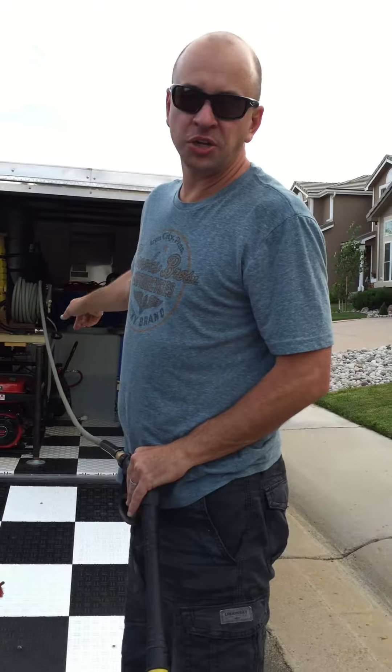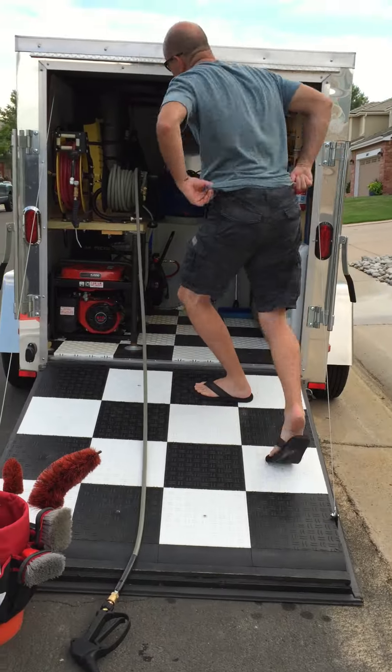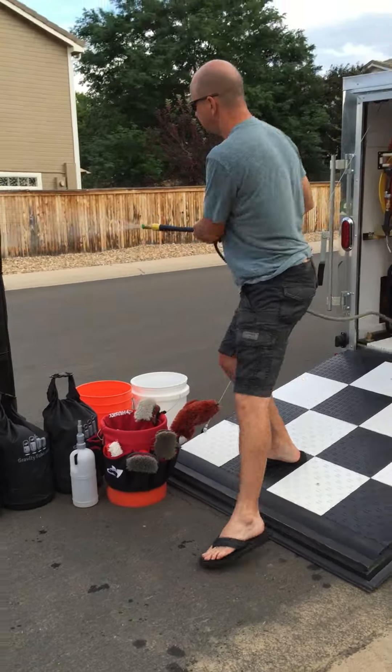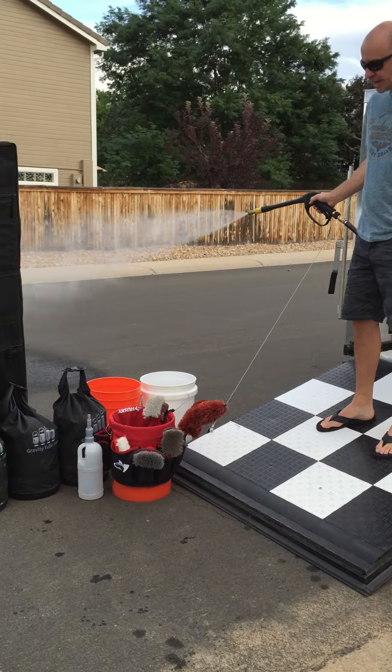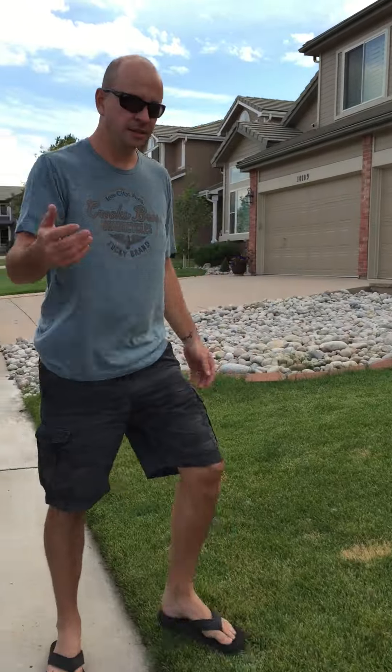While it's on, you can use it for all the devices inside the trailer. The nice thing with the pressure washer is, when you set it down and let go of the trigger, it stops running — so it doesn't build up any pressure and cause you to bust the water line and have a huge leak. I already had that problem using a gas pressure washer. Trust me, the electric is way, way better — it'll save you a ton of time and accidents.